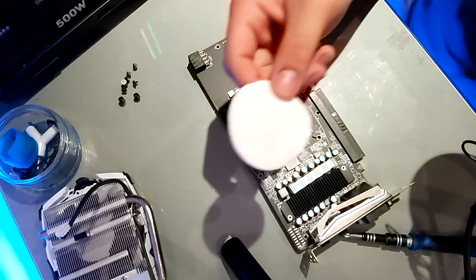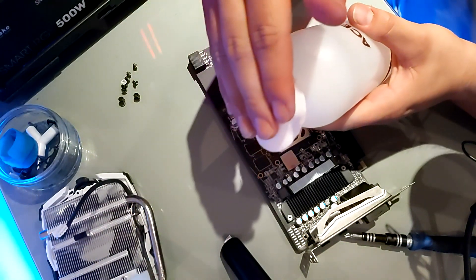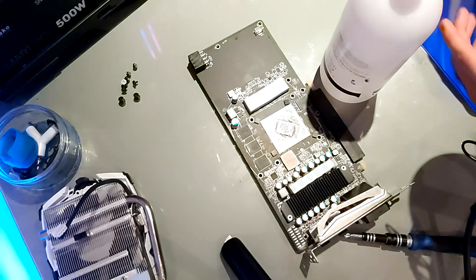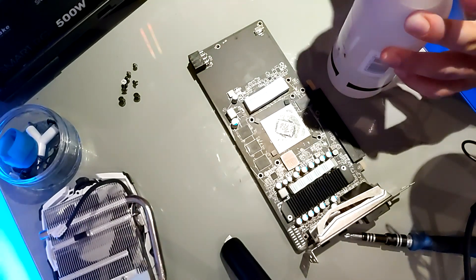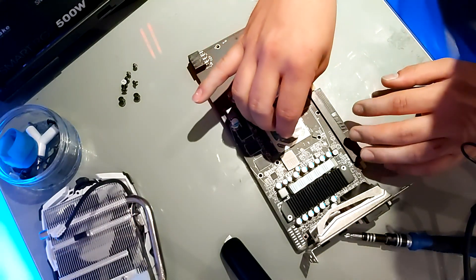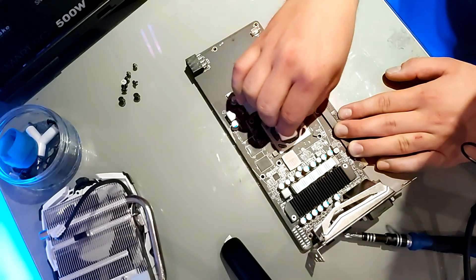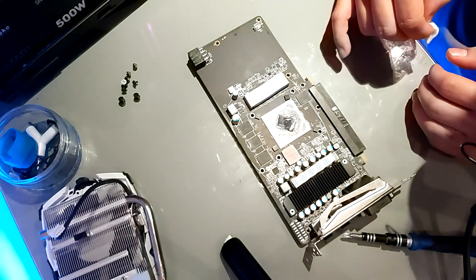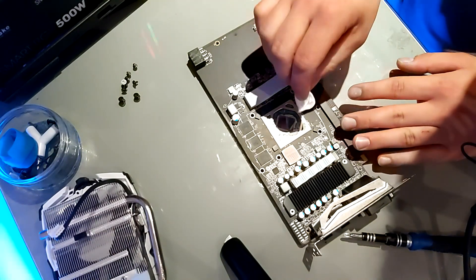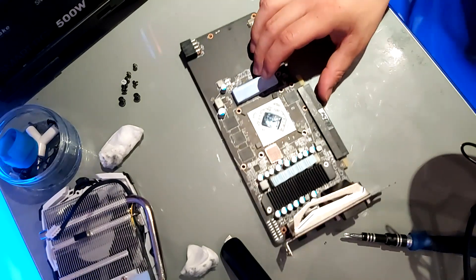With the board rotated, get a clean cotton pad and apply a little isopropyl alcohol or acetone — a quick slosh onto the pad until it's nice and wet. Screw the cap back on immediately because acetone evaporates at room temperature. Then simply start wiping away in circular motions. If thermal paste gets around the chip or on the outside it doesn't affect anything, so you're safe. Clean it up — and there you go, one nice clean chip.